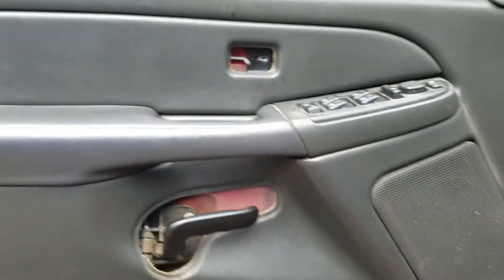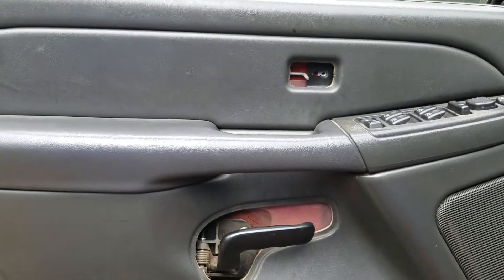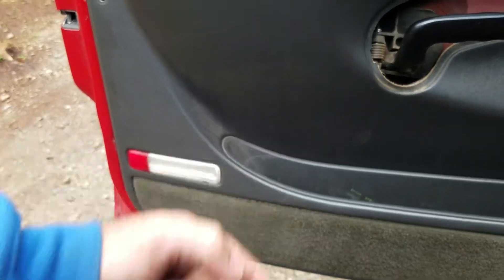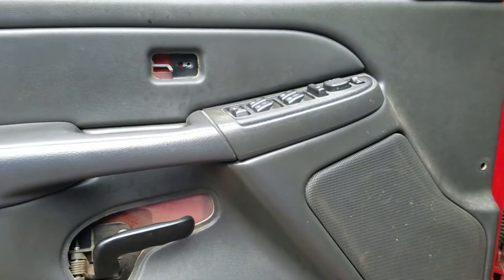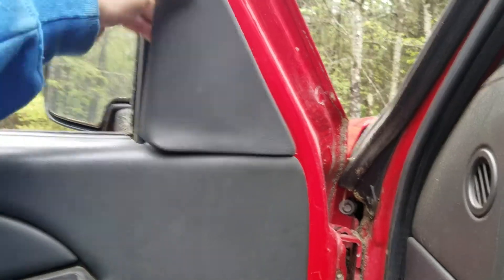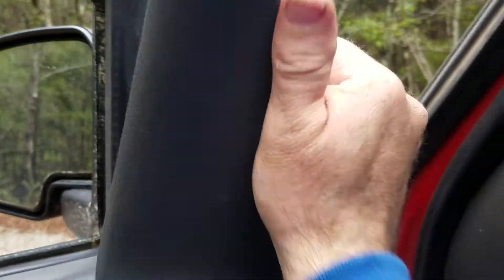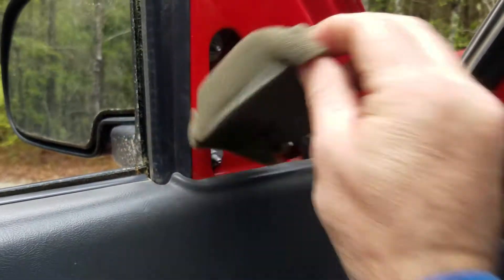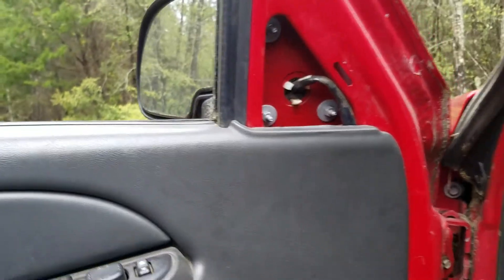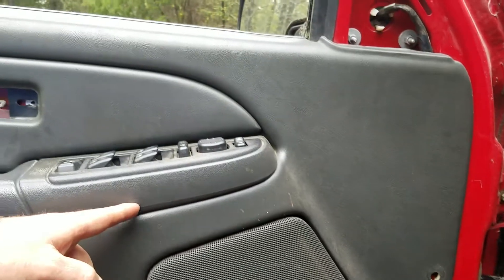Now when you get ready to take this door panel off, all you're going to do is lift up and out. You've got to be careful because there's going to be a wire down there by that light — just slide it straight out towards the front and it pops right out. There's a bunch of wires right there where all your controls are. Once you pop this triangular piece off and take the foam out, you'll see the wire with three 10mm nuts. This wire pretty much runs here, all the way down and around, comes up and plugs in here.